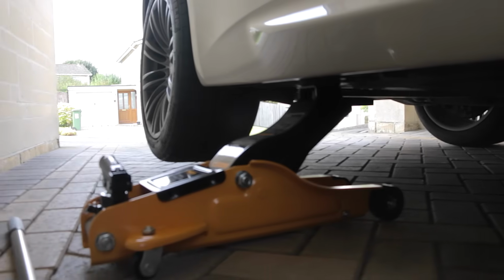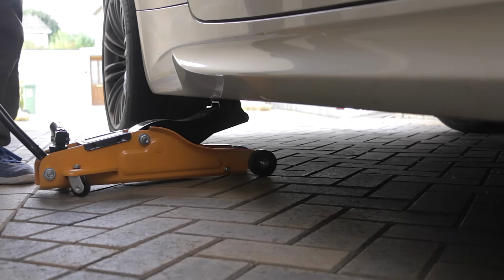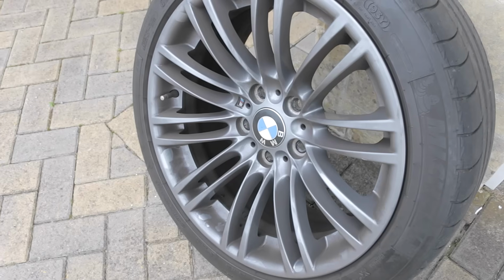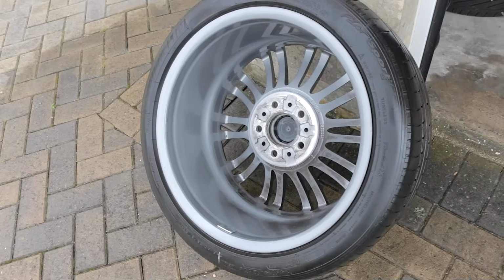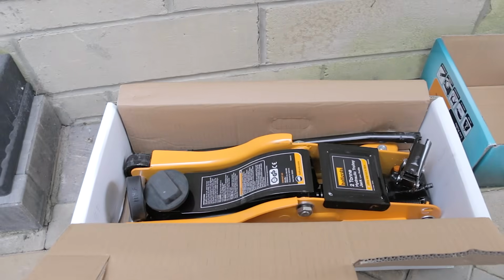But here's the thing, because it's so cheap, I'll never ever trust it for some serious car work. I will never go underneath the car using this jack or do any major mechanical work while it's on it. I simply can't trust it. In my mind, this is just a slight upgrade to a scissor jack, used occasionally for changing or cleaning my wheels, and that's about it. Or if it needs to be, use it to raise the car and put it on some proper jack stands.